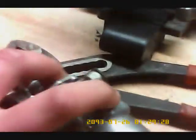So basically, first off, what you want to do is take this bottom bowl off here. I've already undone it. And what you want to do is take note of which angle the float is at. At the moment it is ridge side up. You want to keep it ridge side up, so facing up in there. Make sure you clean out any dirt inside the little bowl and off here, as that will help to clog up your carburetor. Now, here we are with the main carburetor body.